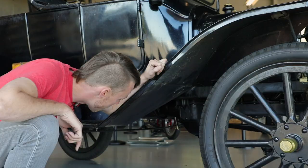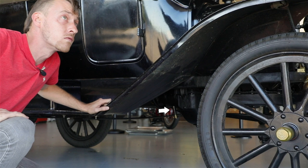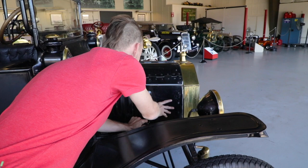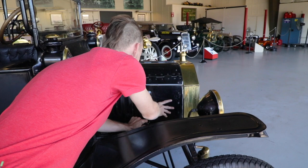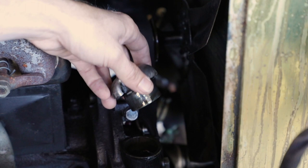On this particular car, there's an oil sight gauge — that brass gizmo right there. You can see the oil level right in it, and the oil also lubricates the transmission as well as the engine. Even though the oil level looked fine, you'll need to know where to add oil. You'll find that underneath the hood at the front of the engine — that little thing right there. You would take that off and add oil right there.